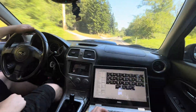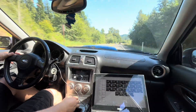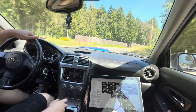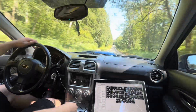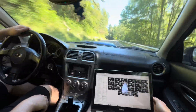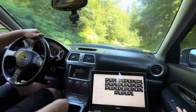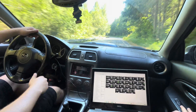There's some air-fuel learning going on — I think there's going to be some adjustment. We'll get a couple more pulls in. Could go left here and I'll go to my secret spot to get a cool outside video. There's a slight stumble; I think I can clean that up. I think it was just going rich way too quick. Intake temps look good — 88.